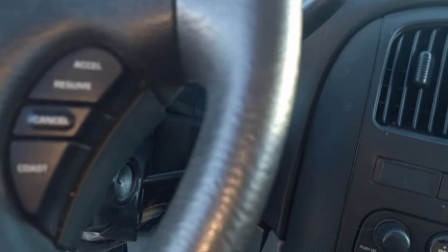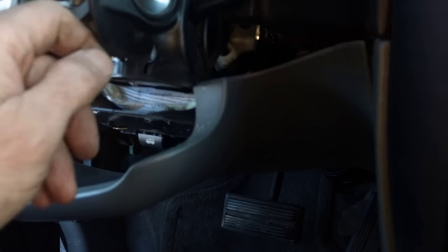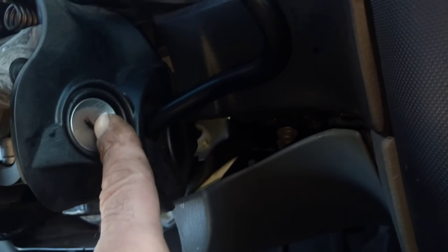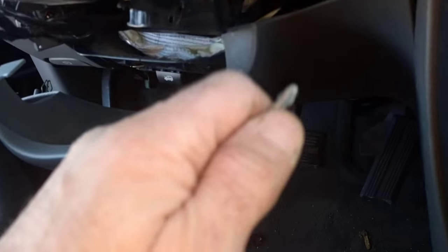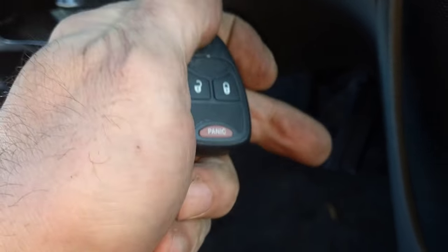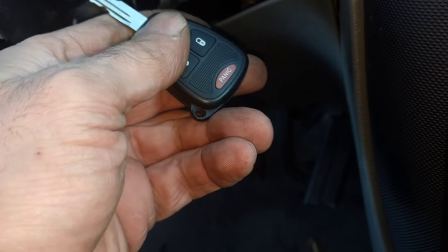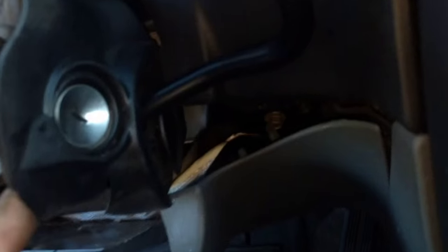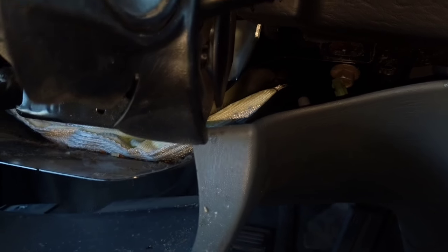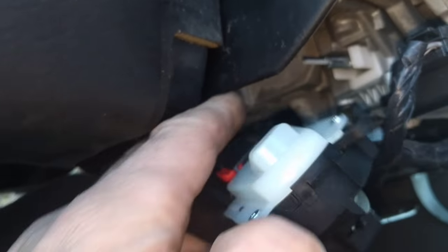You can use up to eight keys if you really felt rich and wanted to have keys for everyone in the house, but it will not work with an unauthorized key. You put the key into the lock cylinder and the tumblers inside match the cutaways on the key. That allows you to turn the lock cylinder, but the chip inside on the circuit board of your remote key fob will activate the SKREEM module and tell the body control computer and the PCM that you're using an authorized key. And therefore the ignition switch — this is the ignition switch here — it mounts back here.